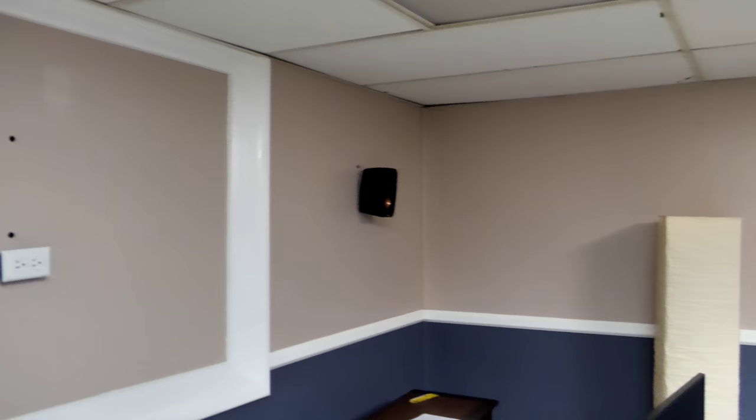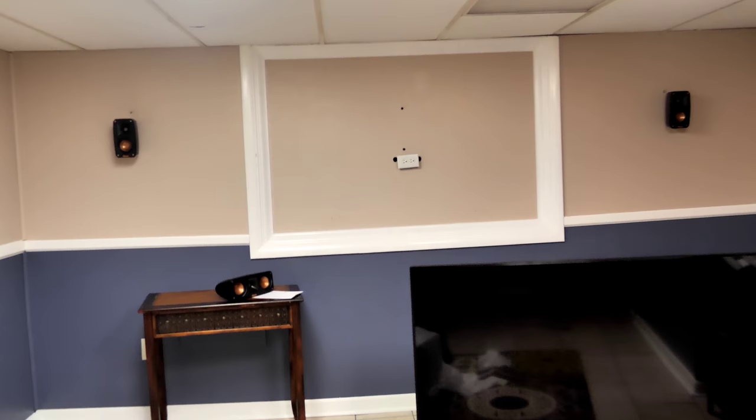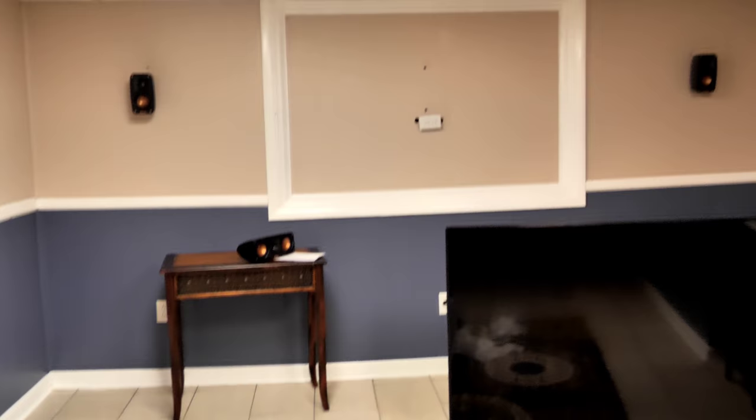apart, which is good. So the center channel here is probably gonna be more towards right down here. I have to see where the TV is going to be, but I think right down there will be the center channel because the TV is 75 inches. So it's going to cover that entire white frame. The whole thing is going to be covered. So I think I'm going to mount the center channel just below it, and that'll actually be sitting right at ear level once he's sitting down back here. So that'll be perfect. And then we can get the receiver and get the subwoofer going. So let's go ahead and mount the center channel underneath there, and then we'll figure out what we're gonna do